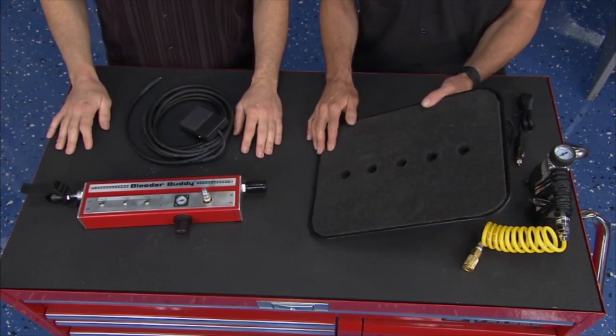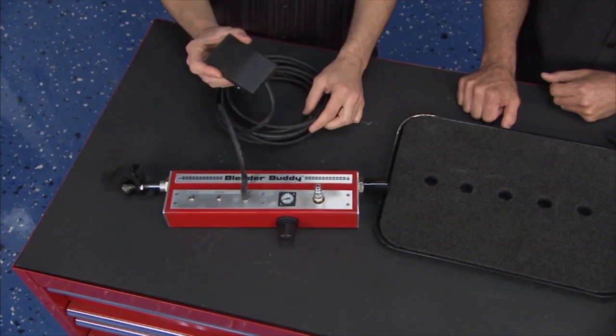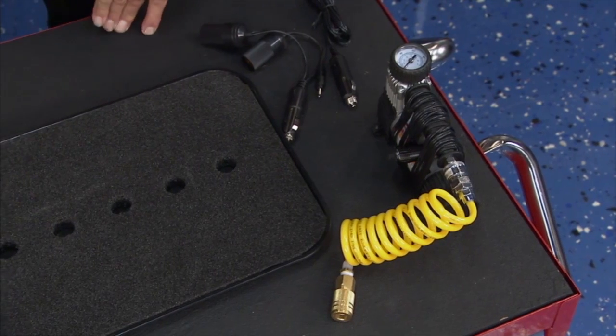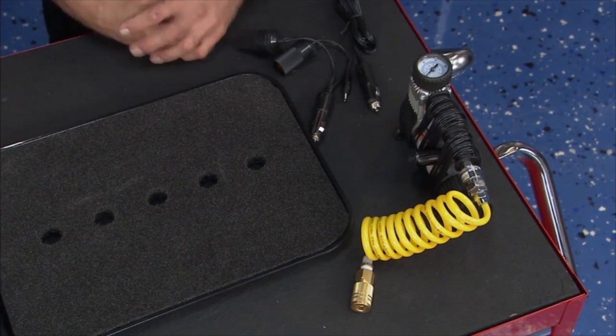You know how it is — sometimes no one's around to help you bleed your brakes. This is a great way to beat that: the Bleeder Buddy from Jammin' Solutions. Put this against your seat, hook in your Bleeder Buddy, and put this on your brake pedal — it's a hydraulic ram. Plug in your little remote pedal and you can run around the vehicle to all four corners and bleed that pedal solo. There's no messy cleanup like with other bleeder systems. Put it away when done. If you don't have shop air, they have a little accessory air compressor — both hook into a 12-volt cigarette lighter. You can also check for leaks in air brake systems, tail lights, and trailers.